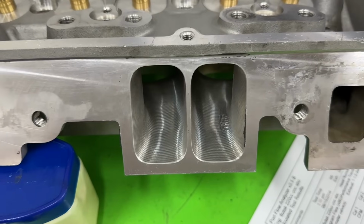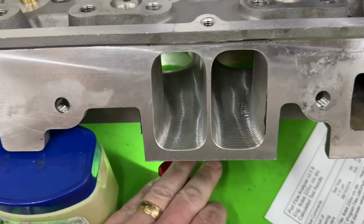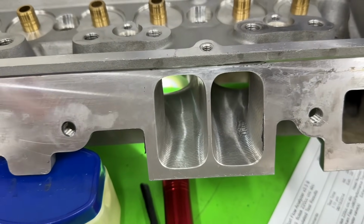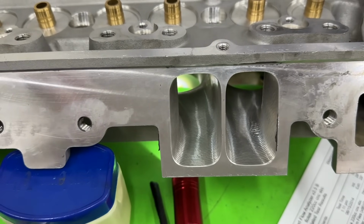I think it was 80 thou, or maybe a bit more, I have to remember off the top of my head, but between 80 and 100 thousandths, that's how thick that divider is, which you're like, that's plenty, it's going to seal. You're absolutely correct, most times, but not all the time.